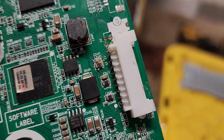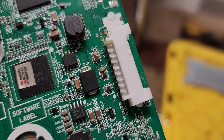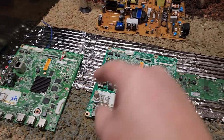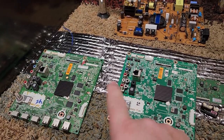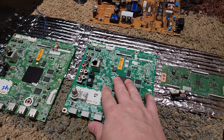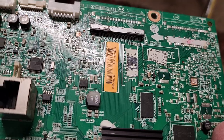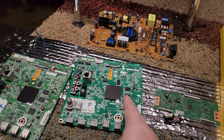This is a board I bought called 'refurbished' off eBay, and you can see right over here by some of these resistors — that's where your standby power comes out. For entertainment purposes, I did switch out the original board for this board. They are supposedly the same software revision. I notice maybe a couple minor changes between the two boards, but the crazy thing is the symptom did change drastically. That's when I had to pull this board back out. I did an in-depth inspection and that's when I found the corrosion all over the board.